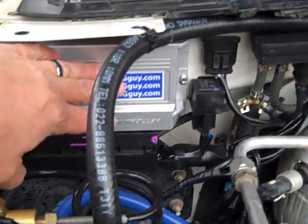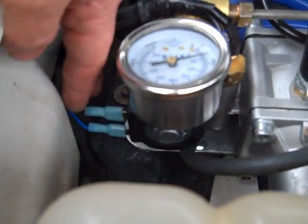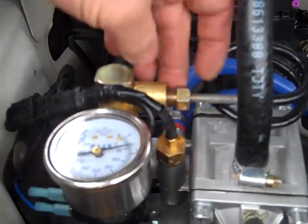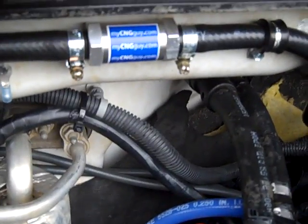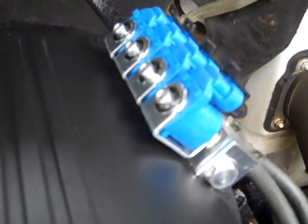So that's part of our computer and some of our wiring. This right here is obviously our regulator with an electric solenoid down here — it's grounded — and then this wire goes to a temperature sensor for the regulator. We use a clear gauge, and this tubing here is your high pressure. It gets reduced down to this two-stage regulator and turns into low pressure, which continues on to the fuel rail. First we go through a filter on the low side, and then we T off to the individual fuel rail on the right and left side of the vehicle.